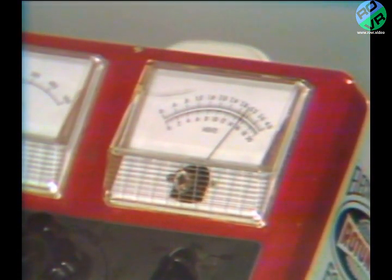Now let's do a second bit of table turning and assume that with the jumper wire installed, our alternator responded beautifully by putting out voltage at or near its rated capacity. In this case, we suspect a faulty regulator, one that has been giving the alternator bad signals so that it couldn't do its job right. Replacing the regulator is the obvious fix.